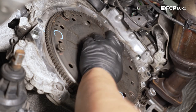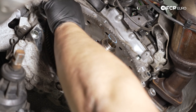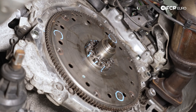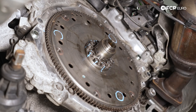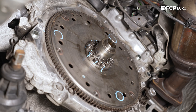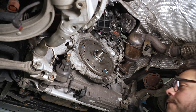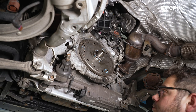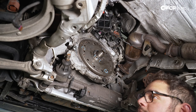These are all torqued up. We're going to take these old bolts out and now we can go ahead and get ready to bring the transmission over. For those of you with an eagle eye, you'll notice that I tucked the harnesses up on their respective sides — I have the one for the gear indicator going over to the right, hanging off the exhaust, and same thing for the harness going on the left. Two 10-millimeter bolts on the shield tabs off each side of the subframe — I'm going to zap them out now just so they're not in our way when we go to push everything back in.